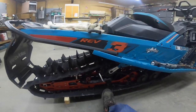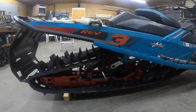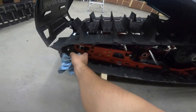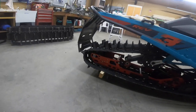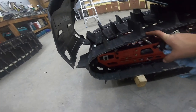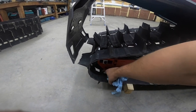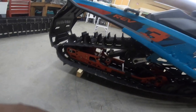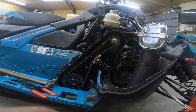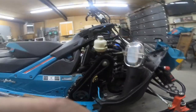I'm not a clutching guru, but with the new track I'll probably just lift it up and check the manual. I know it involves either a roller or a set of weights to get a certain amount of tension. Plus, this is brand new so it's mostly going to stretch a little, so I'll set it up properly to get more life out of it. Don't forget to tighten these guys and take the tension off your rear blocks. The issue with the extensions being a bit longer I think will be okay — the wheel radius is still lower than where it catches and it hits the metal clip at an angle. I just have to put the cover back on and drain the oil and that's it for tonight.